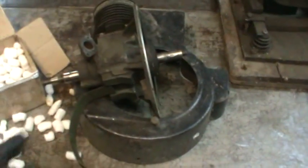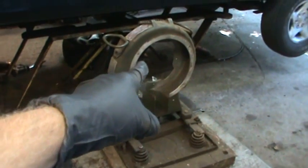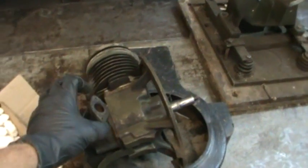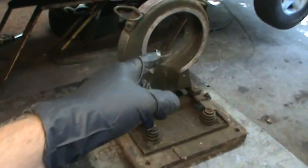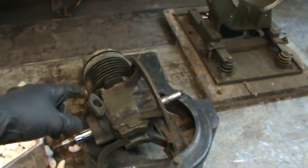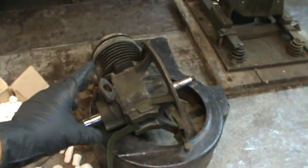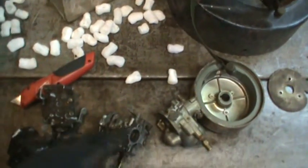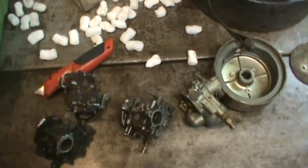So I think what I'm going to do is bolt it in there for a jig, but we'll make the cylinder head facing up, and we'll try to make some kind of a crude manifold coming off of there and stick a carburetor on there. We'll see if we get this thing to fire with these guys, and then we can interchange what we got here and see if we can come up with something that works.